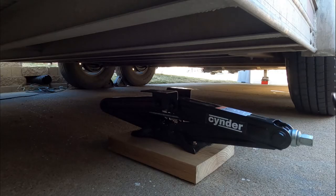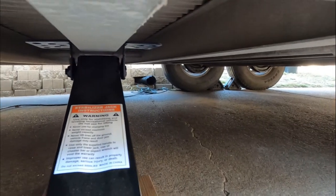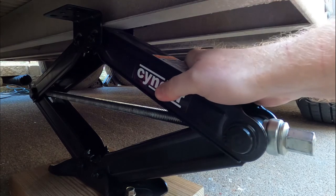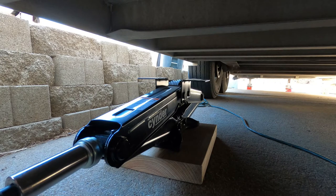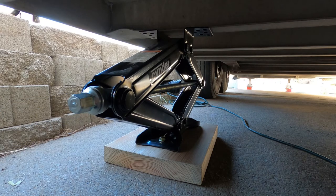I'm using a three-quarter inch socket — I'm going to raise her up. It fits right in there, so let's raise it up just a little bit and get it supported. All right, pretty snug. Now let's do the other side. On this side I can't position it the same way because the retaining rail is in the way, so I'm going to do this one sideways and set that metal plate up on the i-beam. All right, she's secure.